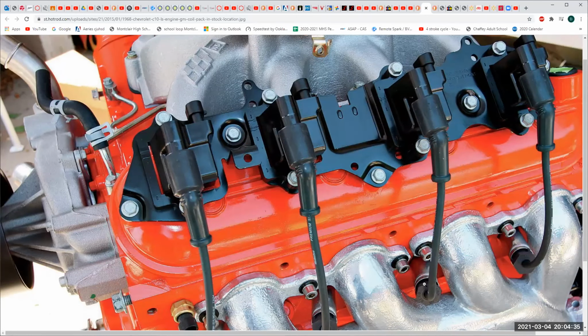But you're not going to have any problems, I don't think, arcing from these spark plug wires to any other. I mean, there's not a huge reliability problem with these spark plug wires because they're so freaking short. And they're not coming close to anything. They're not being routed around anything. There's pretty much a straight shot from the coil straight to the spark plug boot.